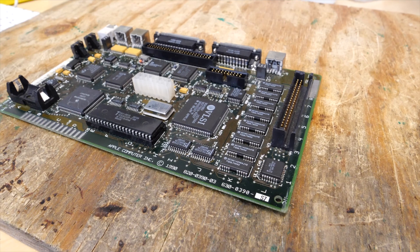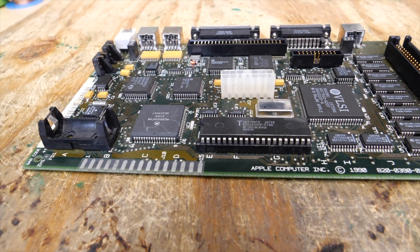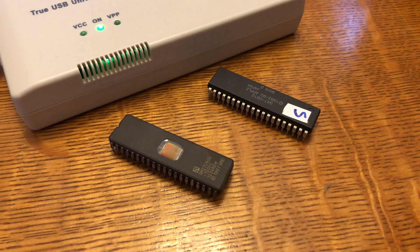If you don't have a replacement Macintosh ROM you have two options. You can find one online — through eBay for example, from someone who parted out a machine where the logic board was damaged but the ROM was okay. Or you can get an EEPROM programmer and make a replacement ROM yourself. An EEPROM programmer lets you read data from existing ROM chips and write data to new blank rewritable chips. There's probably a legal gray area here, but since they don't make these parts anymore and we just want these machines to work again, I think it's perfectly acceptable. As long as compatible chips are still available, you should be able to replace that ROM.